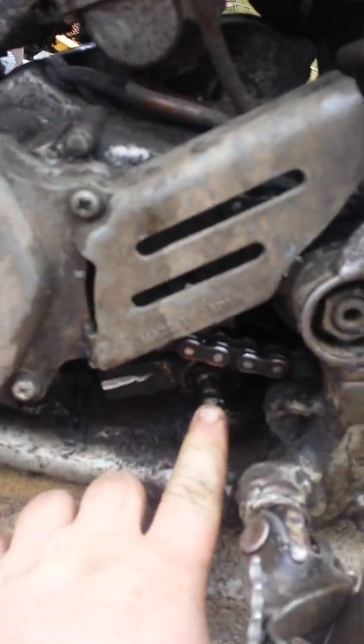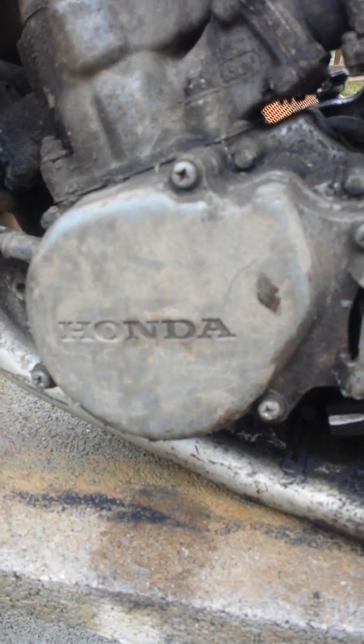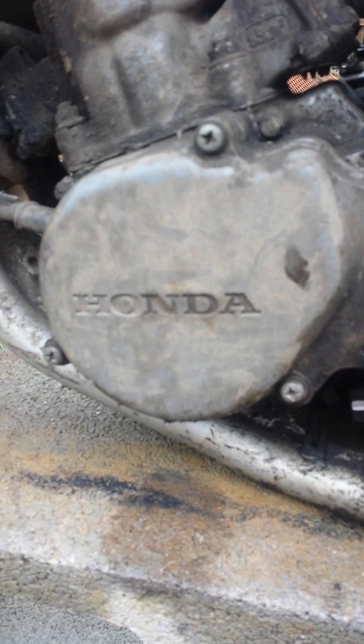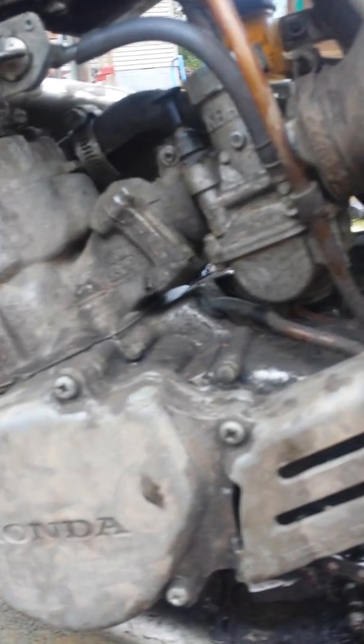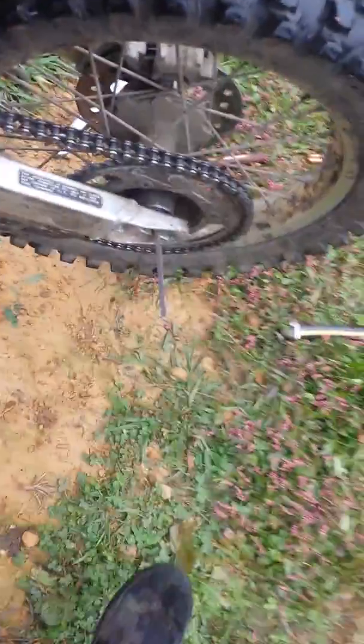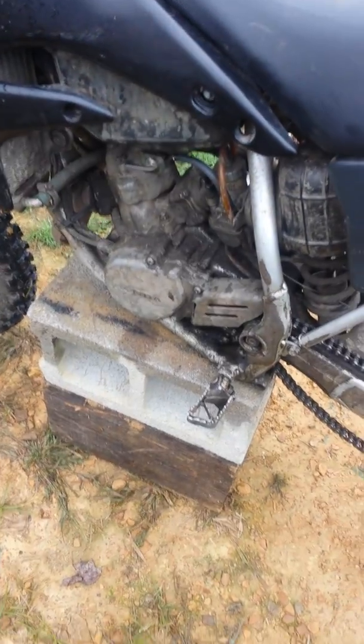It shifts — I've messed with the shift shaft and the shift drum. I think the drum is the problem because it's shifting from here but not actually changing gear. If you know what the problem is, please leave a comment below. I don't really want to put a ton of money into it right now. When I hold the clutch down it sounds really bad because of that piece crammed in there, but it does work. I think it's the shift drum.